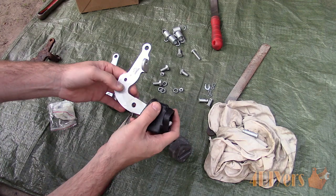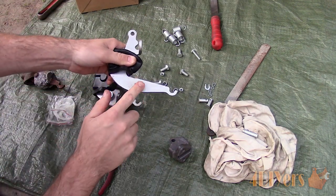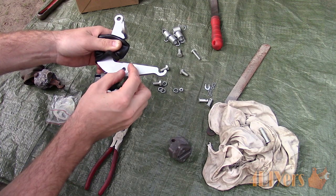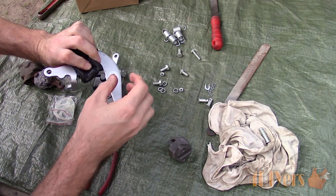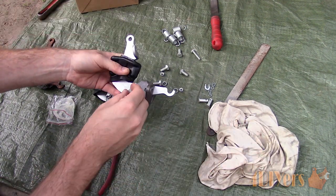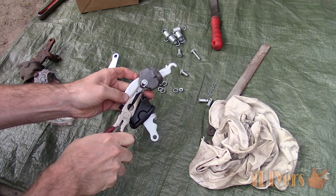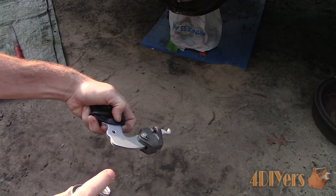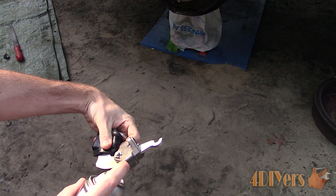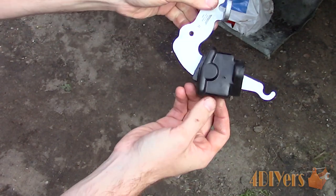New bell cranks do require assembly and you can use your old ones as a reference. I will still cover the assembly process for reference. The kit comes with grease which is applied to the pivot points, both on the pin and bracket surface. Install the rubber boot first. There will be small nylon washers which get installed around the pin pivot. Then install the lever onto the mounting bracket — make sure that mounting bracket is in the correct orientation. Install the pivot pin, then install the retaining clip. Use needle nose pliers to close up the opening on that retaining clip. I did apply a light amount of rust inhibiting spray to where the boot covers, as this seems to be a problem on the old bell crank where it gathers moisture and eventually seizes up the assembly. Make sure you push the rubber in place before installation as you won't be able to do this after. It fits into a groove around the mounting base.